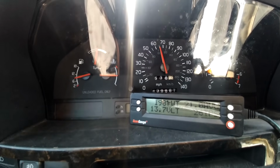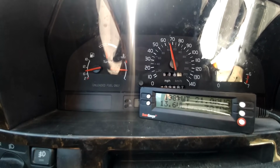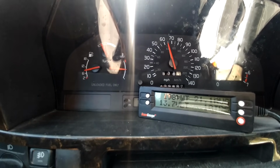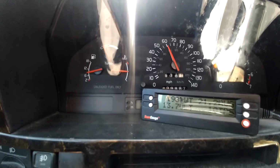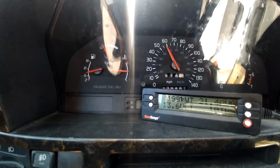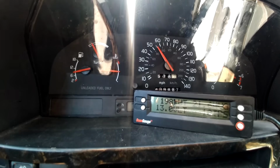Not sure what it'll read at the red line, but if it's ever rising, you want to check, make sure your fan is working, and or deal with whatever coolant problem you have. Your coolant really should never get over 225. So, hope that helps.